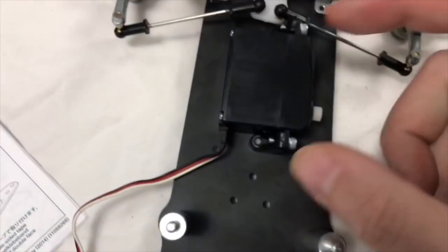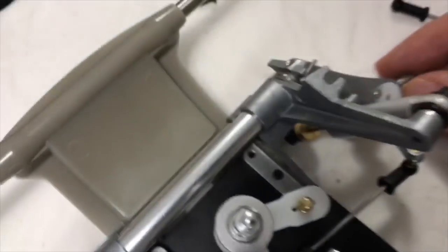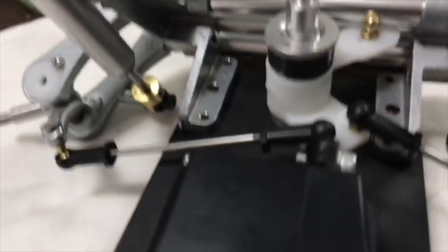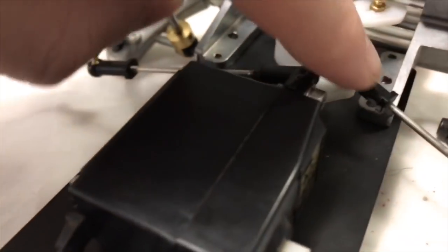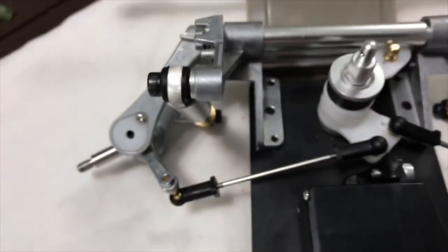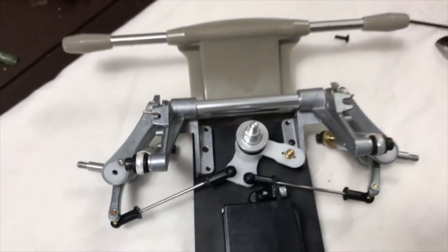So I thought this was interesting. I just started to put the servo in. I slackened the mounts off. Look how close that is to the servo. If I get a bit closer, look at that. I've actually had to shave, you can see it, on this coupling here, I've shaved the corner off because it's on like a square. I've just taken this little bit off, and now, because it was binding, it wouldn't turn, and now it's smooth. God, that's close, isn't it? Anyway, it's working now, so let's battle on.